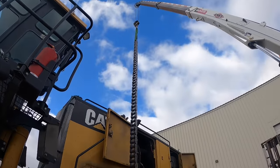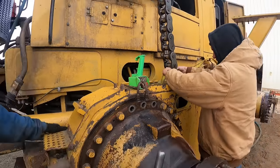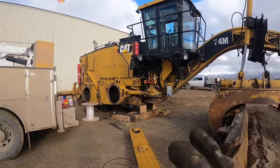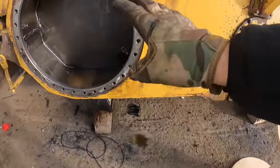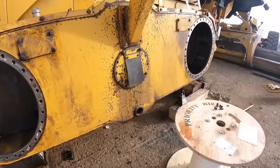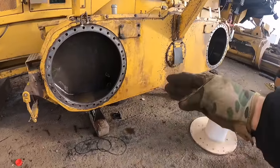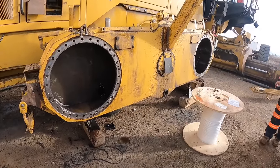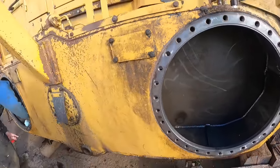This is the second chain going in and we're just slowly feeding it straight down. I wanted to show you guys - if you notice these little jack stands, all they're doing is making this thing not oscillate. We have all this jacked up with dunnage so it's all safe there, this is just to stop it from rocking back and forth. This thing weighs about 2,000 pounds and we've got two three-ton jacks on our feet, so we're all good. Working on getting both tandems cleaned out and getting this all prepped for our second set of brakes.